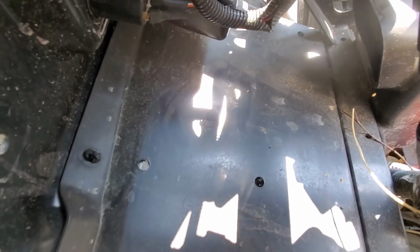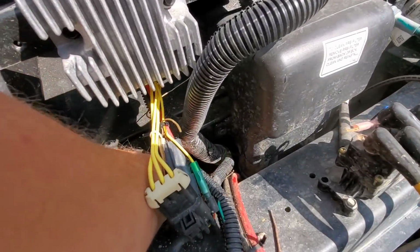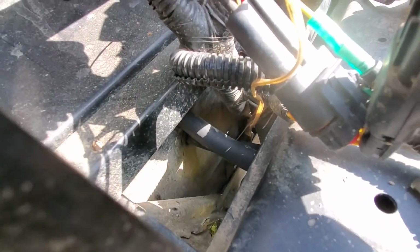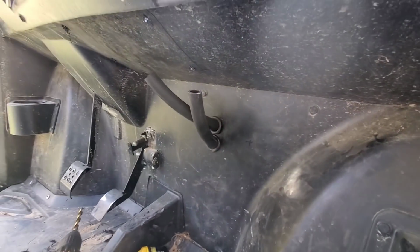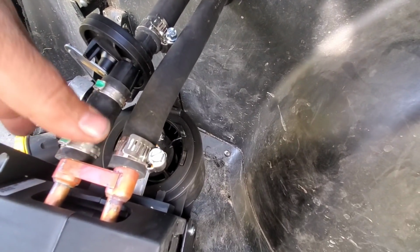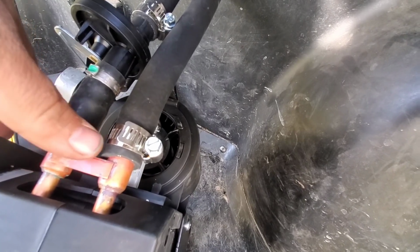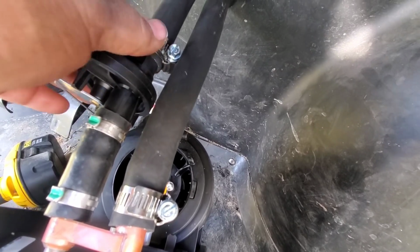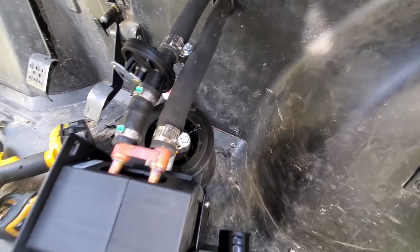So those are the holes. I just fed the 2 ends of the heater hose up through the firewall. They should be sticking out in here. Just put the heater hoses on. For some reason, it explicitly said to put this heater hose clamp on like that. Make sure it's pushed on all the way. I don't really like this one like that. It didn't say to put it that way. I think I might have rather had it on top, but anyway, hook them up next.